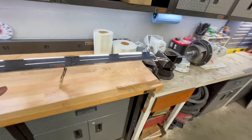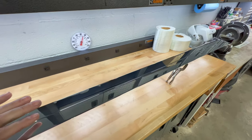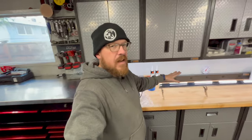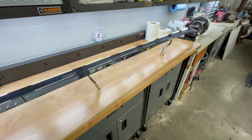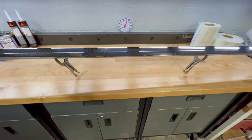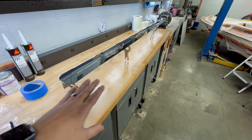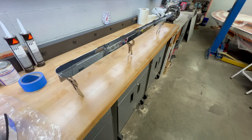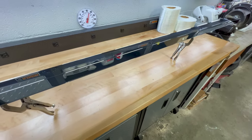While waiting for the fiberglass on the bulkheads to cure, I'm going to attack this aluminum angle using a Renegade Products aluminum mini kit that works with my 8-inch Makita polisher — it should give the aluminum angle a mirror-show finish polish. The end game is we're going to polish the tanks; previously the boat had carpet that went on the floor and up over the tanks, but this is a great opportunity to polish them up and spruce up the back of the boat. I had to sand the angle down to 320-grit first because there were a lot of mill marks.